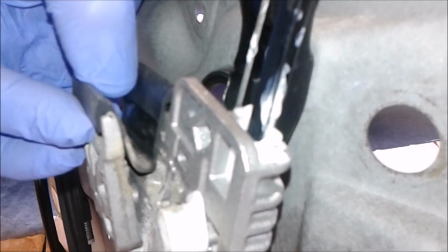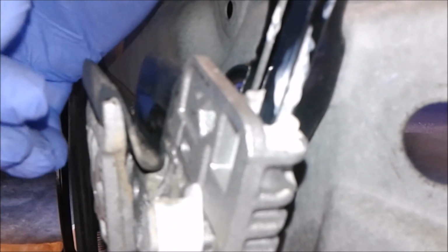Yeah, it's fun. Secondly, if you don't leave that screw in, you can see how this is almost sitting in a V, so you will not be able to put that screw in correctly. It will go in at an angle in this second portion here, and it would not be able to tighten down the glass correctly. So you kind of need to pre-tension it, if you like.